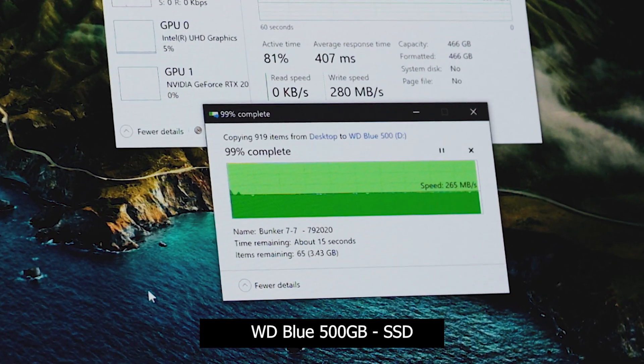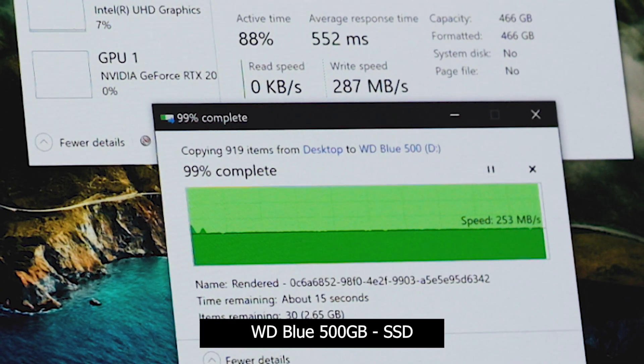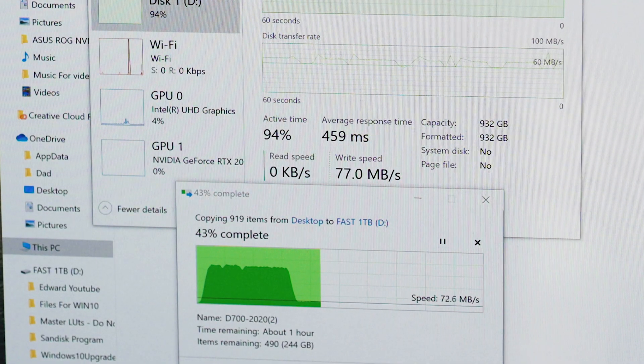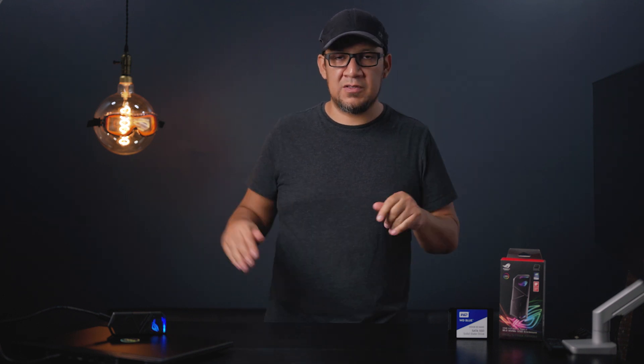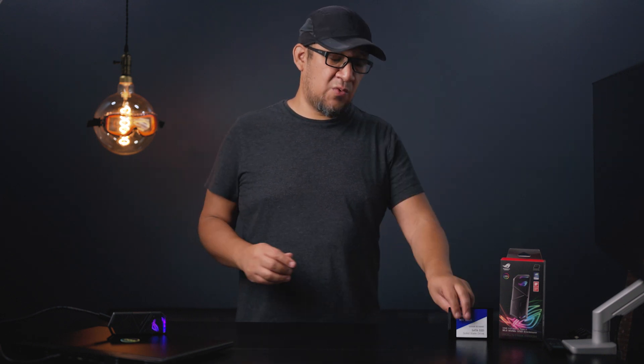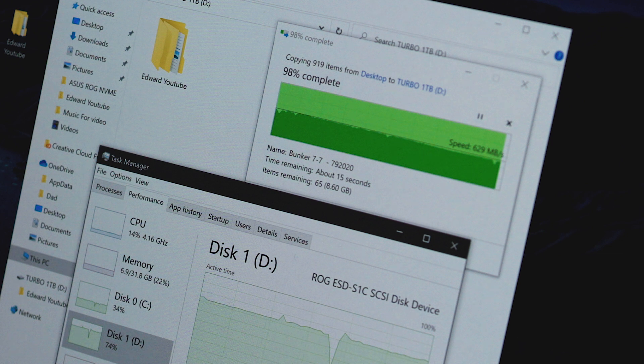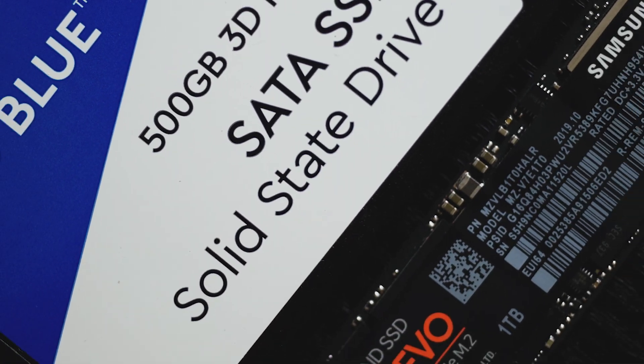I'm not sure if the drive has a problem with the cache, overheating, or can't handle the amount of data being transferred at once. This drive outperforms the Crucial Drive by quite a bit. The Crucial Drive starts out strong at over 650 megabytes per second for the first 130 gigabytes of files. After that it just drops to under 100 — anywhere between 50 to 90, so let's call it around 70. The next 300 gigabytes of transfer took over an hour to finish. Whereas the other drive kept it steady at over 250 megabytes per second and finished in 20 minutes. The Samsung 970 EVO did the best — in 10 minutes it was said and done, finished transferring all the files.